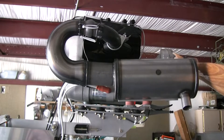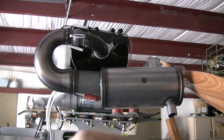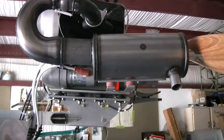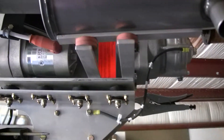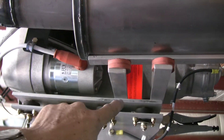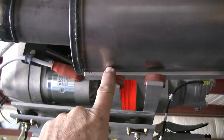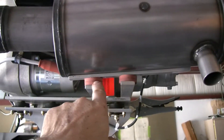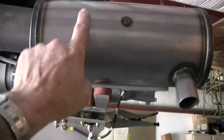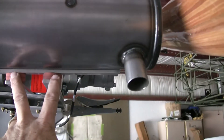Now when you do that, it shifts everything aft. The entire muffler assembly is now moved aft by 3.8 inches, which means that I had to take and move the aluminum mount bars — they were forward, one of them was underneath the starter and the other one back here. Now you can see I moved them aft in order to bring them back and then put the crossbar and the rubber washers on there.